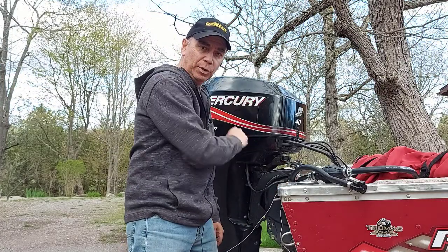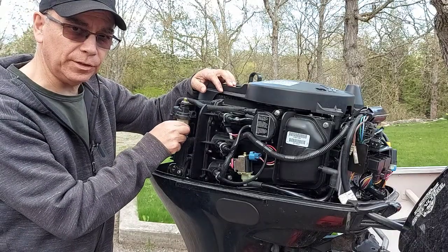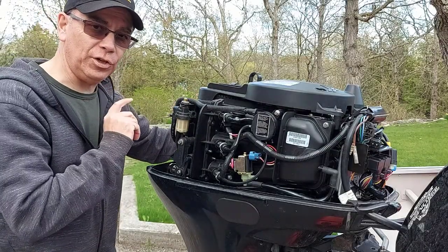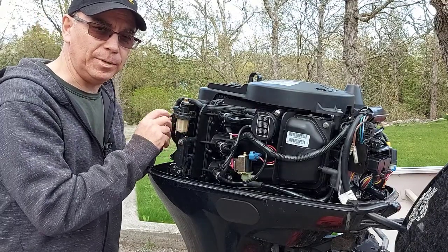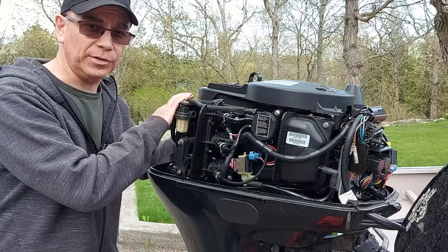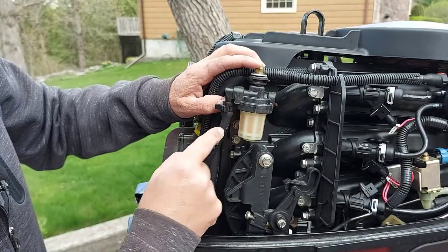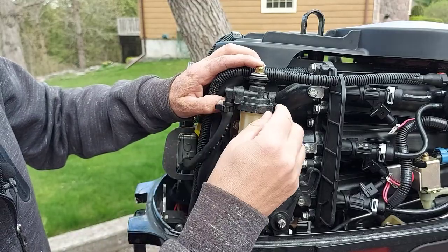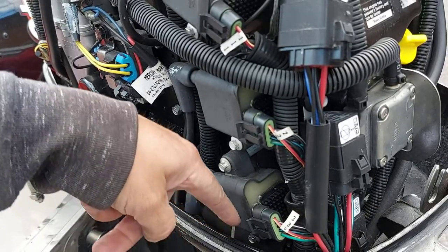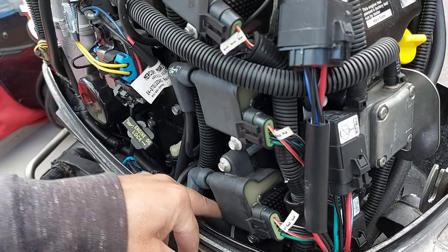I want to show you under the cowling of this motor — right here is your first fuel filter. The fuel came up to this fuel filter and it would clog it up really bad. After here the fuel travels to a high pressure fuel filter over on this side — that fuel filter was okay. If those liner pieces had gotten past that filter I would have had to change it as well. What I did was buy a new fuel filter — this piece and the filter all come in one piece. I unhooked the fuel lines, put the new fuel filter on, and over here on the left side of the engine there's a high pressure fuel filter — if the problem persists you may need to look at that one too, as it may also have debris from the fuel liner.